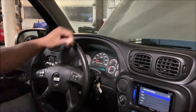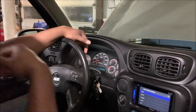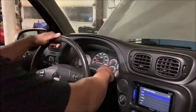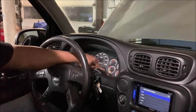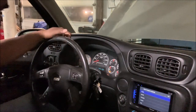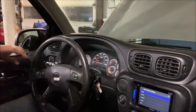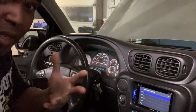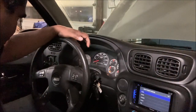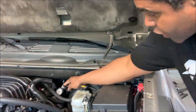Remember, I only have one gallon of gas in the truck. Let's try to start this vehicle. It's running — and as you can see it's on E, with one gallon of fuel in the tank. Look at the yellow fuel light — it just came on. The truck is raised in the back seven inches right now. With the stock pump, this truck wouldn't even start. It only has one gallon of fuel, so the siphon is scavenging fuel from the front of the tank to feed the bucket. This is awesome.